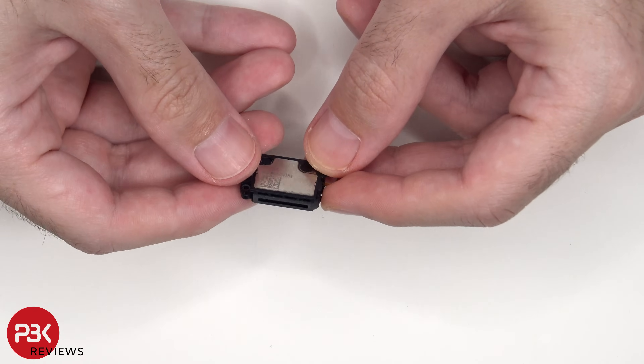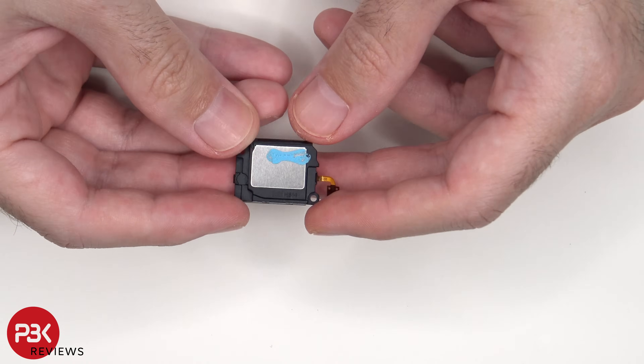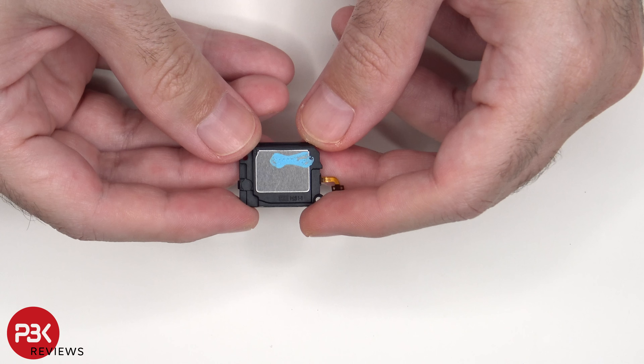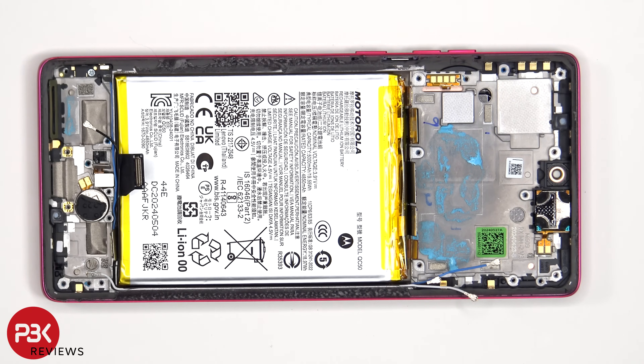This is the bottom speaker, and there's some thermal paste underneath it to help transfer heat. Once the speaker has been removed, we see an antenna board on the bottom corner, which the blue coaxial cable is connected to. The vibrator motor is located here, which is held on with some adhesive. To replace that, just apply some heat and pry it off. The same goes for the fingerprint sensor.